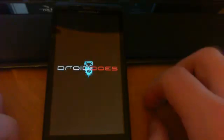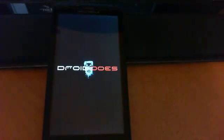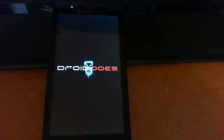Note that the first reboot can take up to ten minutes — do not reboot the phone and do not pull the battery, as that could potentially mess it up. If you're stuck in a boot loop — where the boot animation repeats over and over — then you may take out the battery and reboot. If everything works well, you should be able to boot successfully.